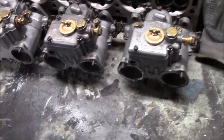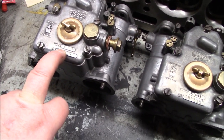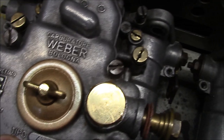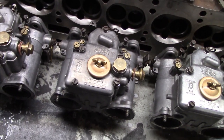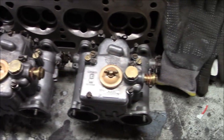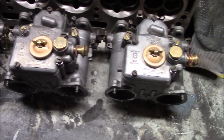Carb time. Here are the carbs we're going to be running — they're Weber DCOE 2 40s. These are about 30 years old, Italian, made in Bologna. I did clean them up significantly compared to what they looked like when I took them off the car. I'll link to a video of me soda blasting these and doing a few other things and rebuilding them. They have all new internals and were put into an ultrasonic cleaner after soda blasting, so internally they're very clean.